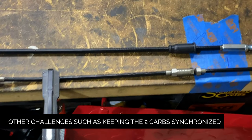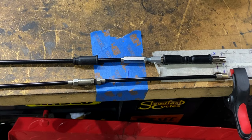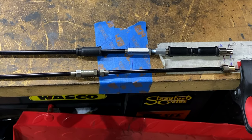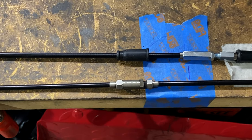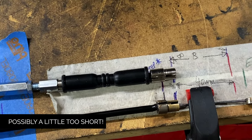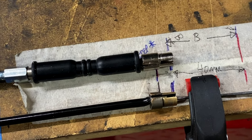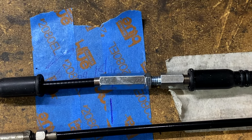At the far end going up to the throttle, I've introduced the adjuster a little higher up — quite a bit higher up. It's half the measurement of the original one, which I think was six inches, and now it's at three inches. Looking at that step, I'm out by about a millimetre, so hopefully there will be sufficient adjustment here to take care of that.